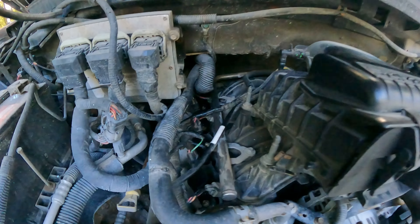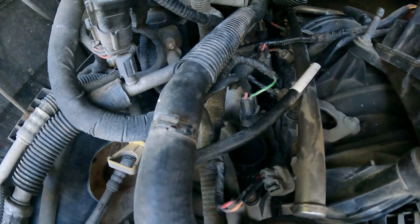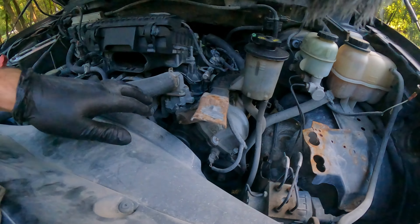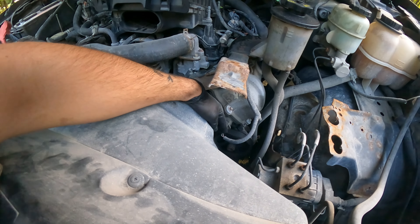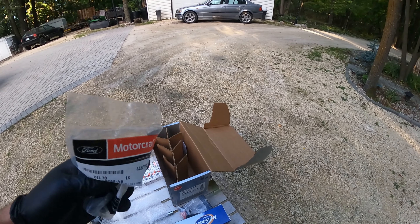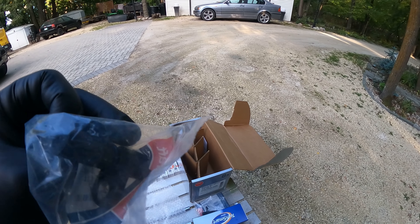After a little bit of work, we've switched all the ignition coils over — they're all in there now. You can see the new black pieces. Now I'm going to work on the crankshaft position sensor. It's right here — I think it's just one screw. It looks like yeah, just one screw, then it pulls out and I plug the new one in and we're good.